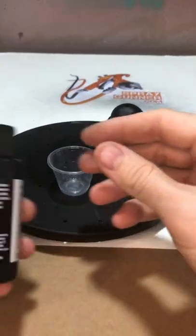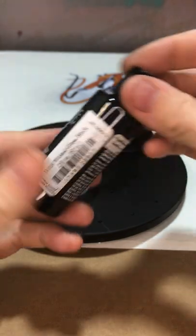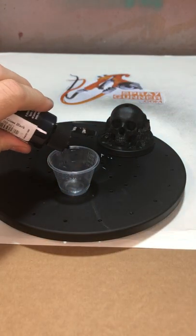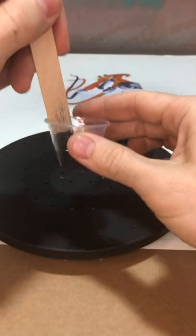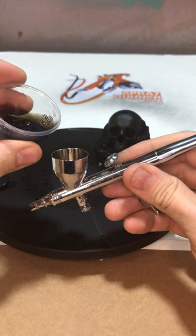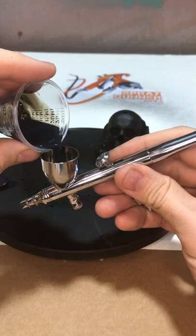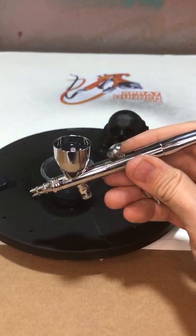This primer does not. The flat black is not dark enough, so I want to use some gloss black to base them with. I will be 2K clearing these, so any dark or deep black will work. I've mixed the W18 with some 4011 reducer at a 10% reduction and applied a few coats. I'm also using the PS289 for this.